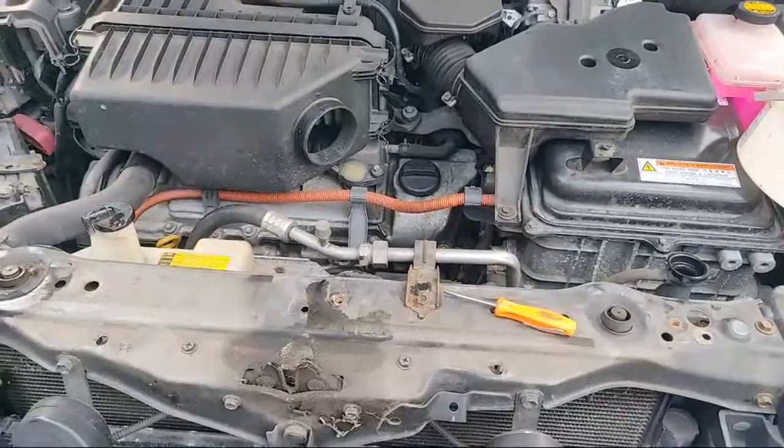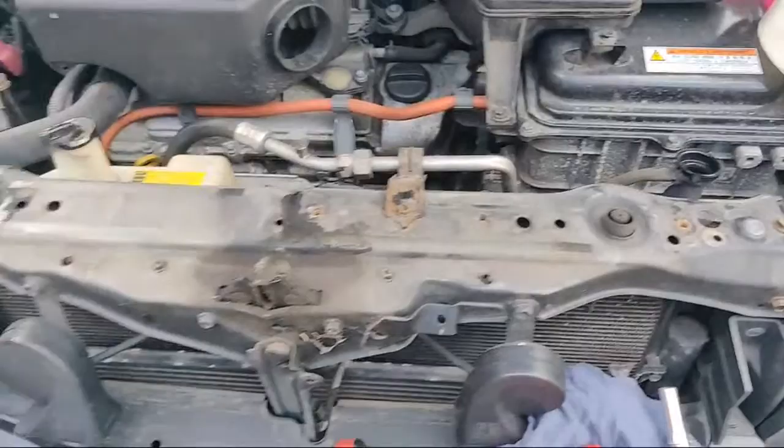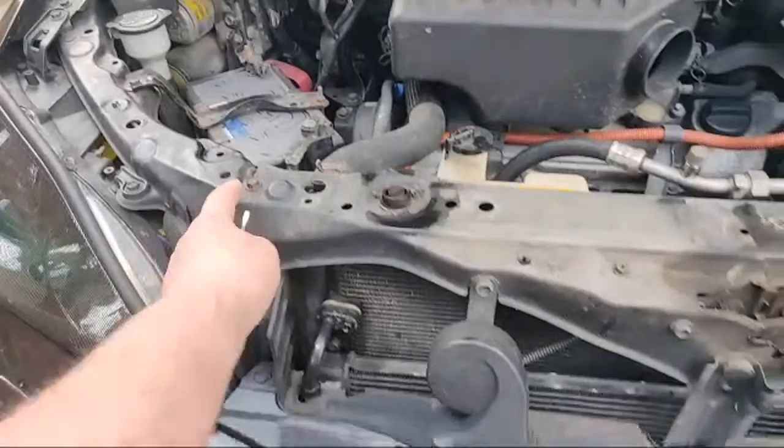Obviously the vehicle's cold — made sure the vehicle was cold before taking the cap off. We've got our gloves on so we're just draining the coolant. It is new coolant so I'll probably sieve it and reuse it. Now the next part is to take this bonnet catch panel off.